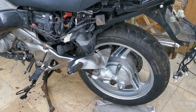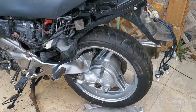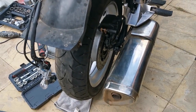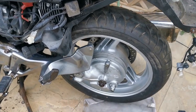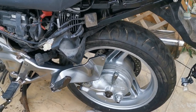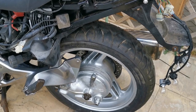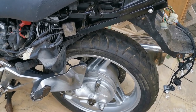Just a quick update on the NT700 — the bolt came from the swing arm and went straight in, which was really good. That means the caliper is on properly and I was able to button up the exhaust. It's clean with new brake pads in it. The only thing I'm waiting on now is to change the gear oil in the final drive — I've been told it's out for delivery. Once that's done I can start rebuilding the back and then concentrate on the front. Hopefully it won't give as many challenges as the back did, but on the home straight now.